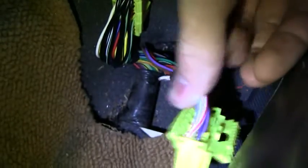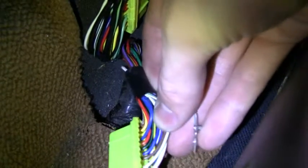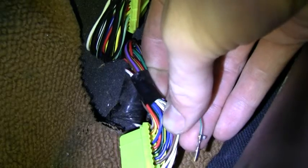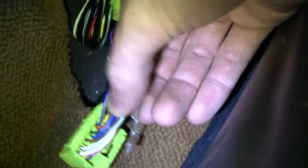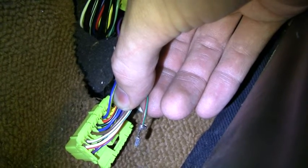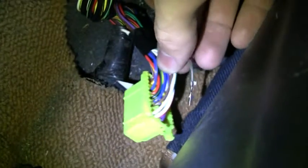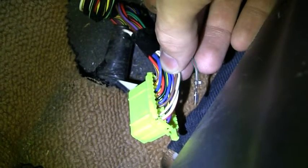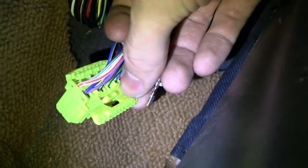Now, in case you're wondering why you're doing this, the wire that we're going to take out and put in that spot is the yellow and white wire, this one right here. And you may recall that just so happens to be the same one that we hooked up to that intake air temperature sensor. So however Flying Miata designed the ECU, it's set up so that temperature has to go into that pin over there. So that's all I had to say about that. So we're going to get that swapped over and bolt it back in.